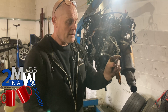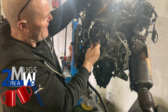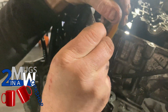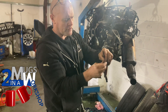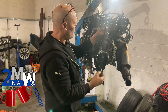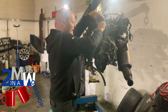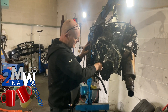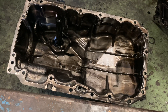You can see the wear on this top peg located in the cylinder head — the timing chain guide sits through there, but this one was totally disintegrated, found in the bottom of the sump in about 25 pieces. We're going to replace it: drop the new one in, locate it on the pin, nip the bolt up for now, then proceed with the other guide rail and the other tensioner rail. We'll build all the timing gears up and do another video showing all the components in the correct location. Mark's also cleaned out the sump on the N47 — quite a lot of debris in there.